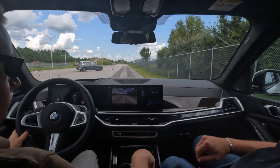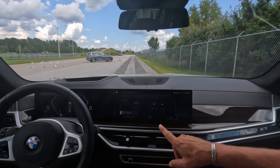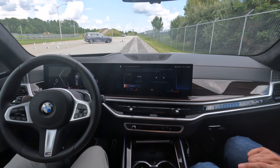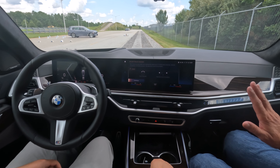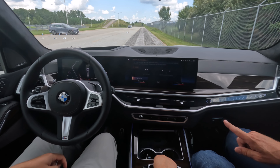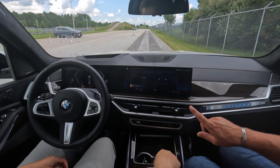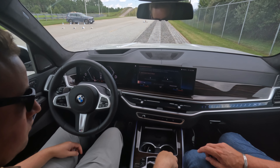So now you want to back up your trailer into your garage — go in reverse. Once the car reaches speeds above 10 kilometers or 6 miles an hour, it cancels the system. So what you have to do is use the brake and accelerator and leave the steering by itself. Press continue.